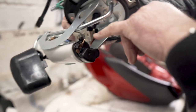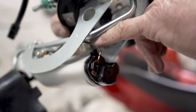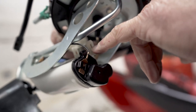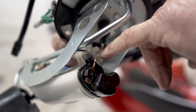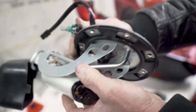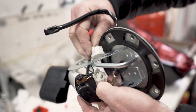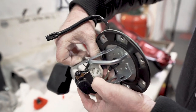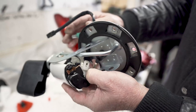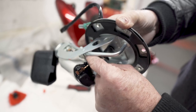So if you can look in there, that's a fuel pressure regulator, a shiny silver bit. We're going to remove that and we're going to compress it to increase the fuel pressure and then put it back in. So the next task, after getting this little cap off the top, is to get the silver part out, compress it and then put it back in again, and this will give us 5 bar of fuel pressure instead of the 3 as standard. So Tim's just going to get a little pry bar just to lever that out, because it's going to be tight in there.